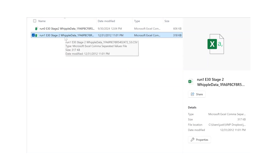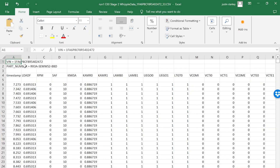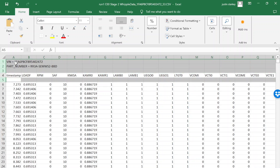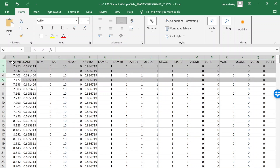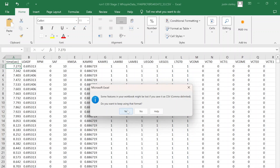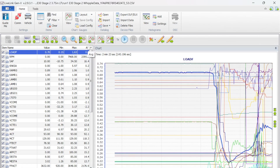So I've got my data log here — I've already renamed it to match my dyno run file. We're doing some E30 testing right now with the stage two kit, so that's what it's named. This is a CSV file, which is a generic format for data. I'm going to open that file and make some quick edits. Whipple's data logger saves all these parameters in here — you want to delete rows 1, 2, 3, and 5. Now you've simply got headers: time versus parameters and data below it. I use SCT Live Link to look at data — rename 'time' to 'time (seconds)', save it as a CSV, and now SCT Live Link recognizes it as a compatible file.